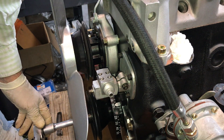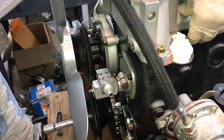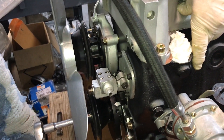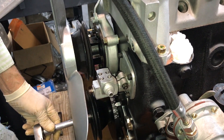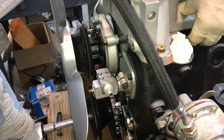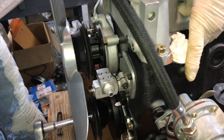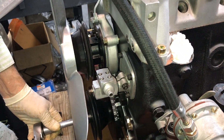Alright guys, let's see if I can duplicate what you've got going on. I've already started to set this out to top dead center, but I'm going to rotate it again to show you what I'm talking about — checking compression with your finger. Okay, that is compression, and I'm coming up on OT. Let's do this again just to show you. There it is, pushing my thumb off.